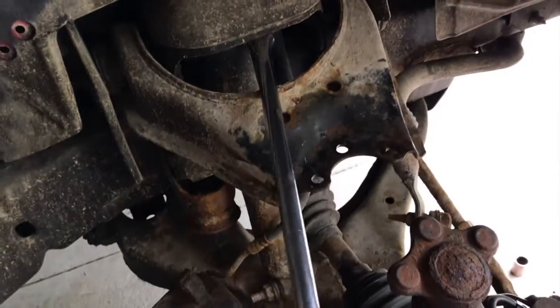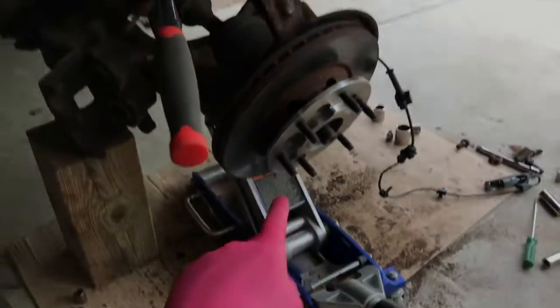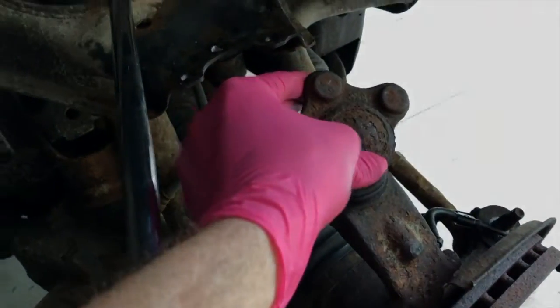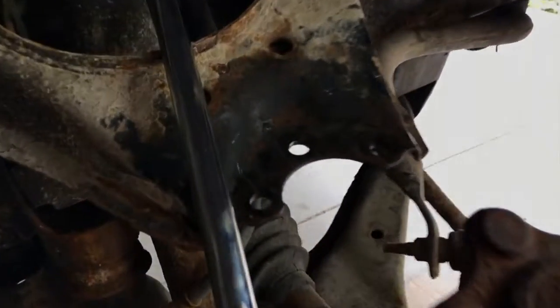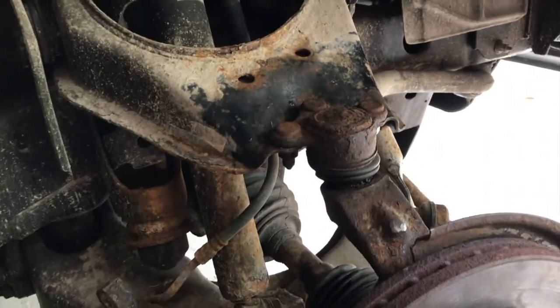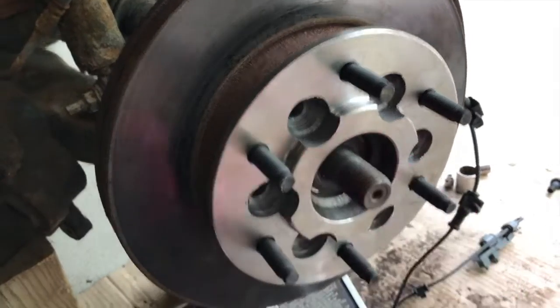From here, again, early in the project, I mentioned this is a spring tension type part. I have jacked this portion of the hub assembly up, and I'm going to shift this upward and at the same time push this down and align it properly in those 3 holes. Again, just be careful as you align it properly. Do not harm that thread. Making progress, the upper elbow mount is secured, and from here the ring goes in.